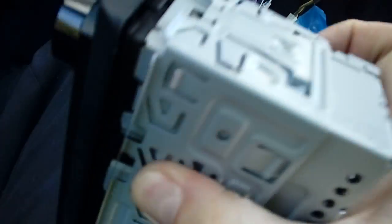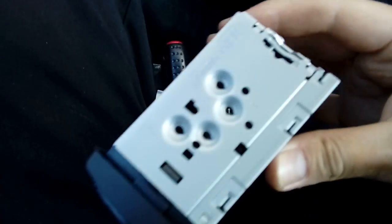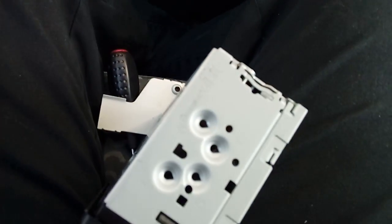Your radio will come with a cage around it like this — you're going to need to remove that. Just pull these little tabs up and slide the cage off. You only need it for European fitment cars, so put it back in the box and keep it just in case you sell your car and keep your radio. This particular car you're not going to need it, because you're going to be putting your side brackets on that you just took off from the original radio.